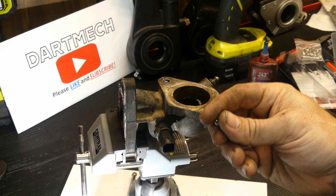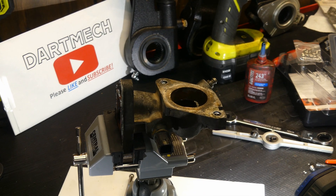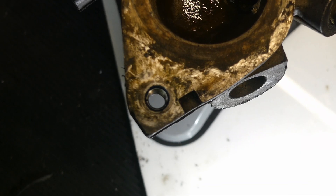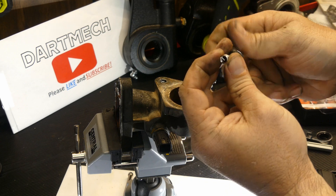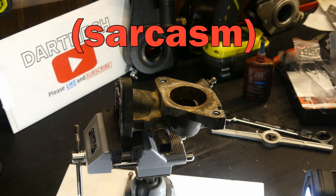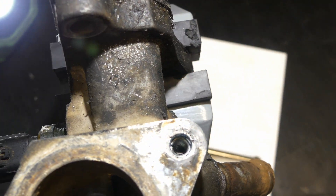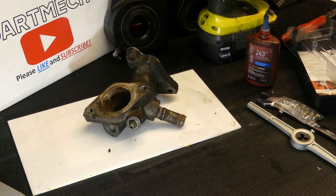Now I'm going to go ahead and knock off the little tab — that center piece that you install onto the tool — you've got to knock that off. That's what this tang breaker is for. If I set it in there, hopefully you can see that little tab sticking out — I need to get rid of it. You take this, sit it in there, and hit it with your favorite hammer. There's the little tab — if we look down in there, it is now gone. You don't want to forget that step, because your bolt will thread onto the new coil and then hit that tab, and as you keep threading it, it'll try to expand the threads and you really don't want that — it'll either mess up your bolt or mess up your new threads. The other hole's tab is down there flush with the bottom of the bore, so I think we're going to be okay.